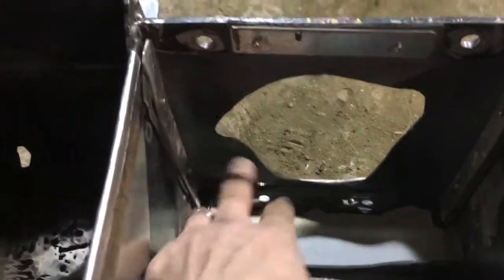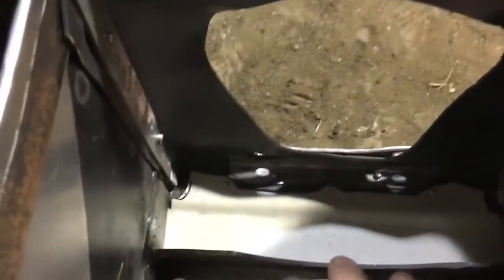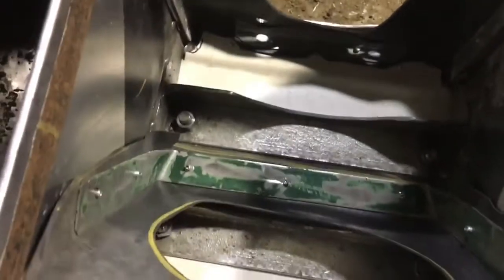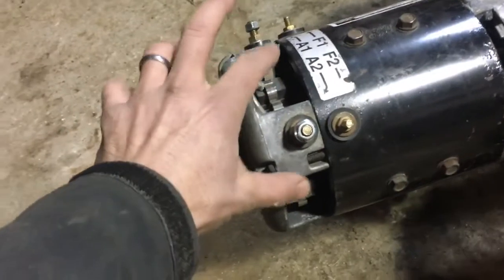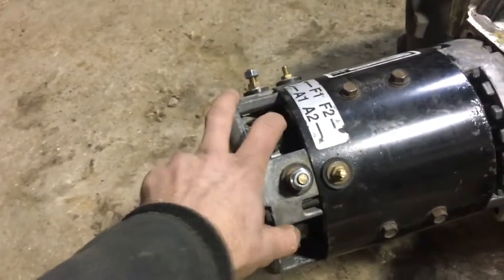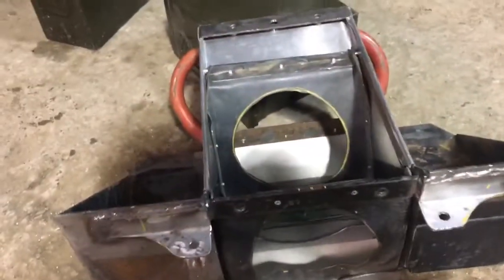I spent a fair bit of time working on airflow control. This rubber surround is held in place with plates that are riveted here, here, here — and one really irksome one down there. The motor comes in through the rear and these two will seal around it, managing the airflow so that air will always be aspirated as intake over the brushes, through the housing, and expelled out of the fan — then the airflow will be further managed.